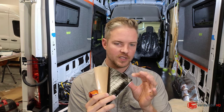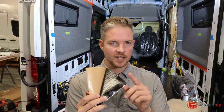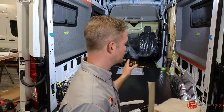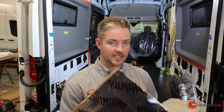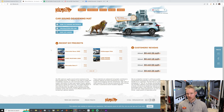This material comes in different weights — a 50 mil is the thinner version. Thinner is easier to cut for the floor; thicker works well for walls which sometimes make more noise. The Adventure Wagon kit we purchased for this build included the sound dead material. By adding this to the van floor you're reducing road noise and creating a quieter environment inside. No affiliation with any products — just helpful information.